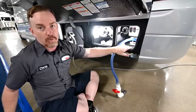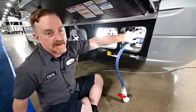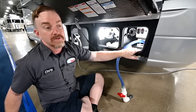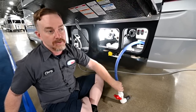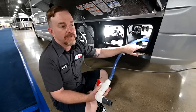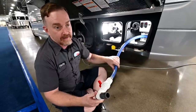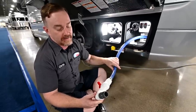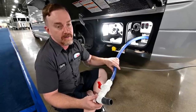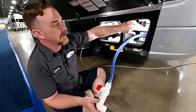Go inside and add your tank chemicals straight into the toilet. You should allow the black waste tank to sit with about that much water in it at all times, so as you're driving, that water is sloshing around helping keep the sides of the tank clean. Your sensors will read accurately, and waste will be trapped in chemically treated water and exit the next time you dump. Once you're finished with the black tank, come outside and do the gray tank second — gray tank is mostly soapy water from your sinks and showers and will help wash the piping out. Take care that you do not open both valves at the same time, or the black tank will flow into the gray tank and contaminate it. Do not leave your valves open at your camping site — leave them closed until you're actually ready to empty the waste tanks.